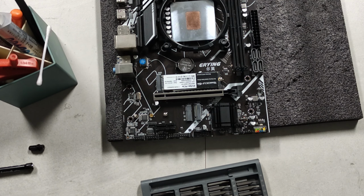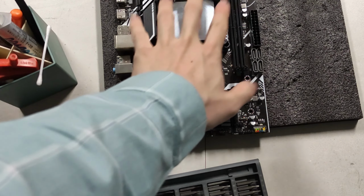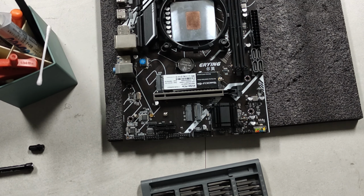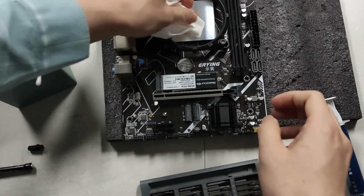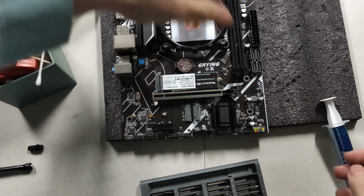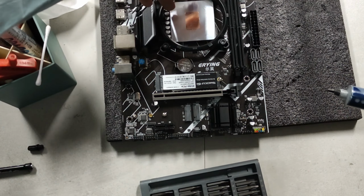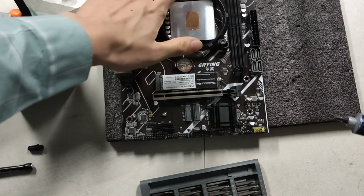I think this is going to be more of a permanent installation, obviously, so since the top here is going to be very, very hard to coat, we're going to use thermal paste. We're not going to go the full monty, because it's going to be too risky. If any of that liquid metal spills onto the aluminium, it's a bit of a game over. So yeah, you have to be very careful with this. But they do a really good job of machining this nearly completely flat. You can see that even on the aluminium part, it's perfectly flat.